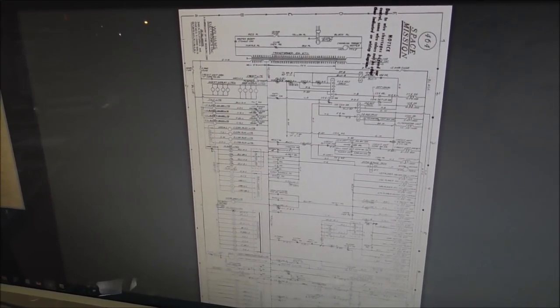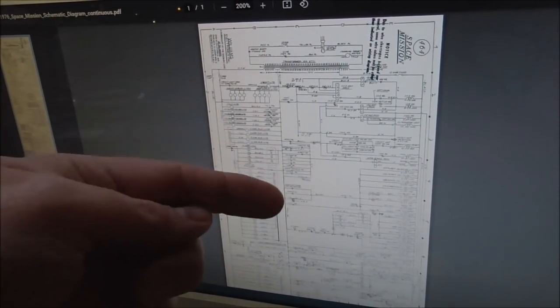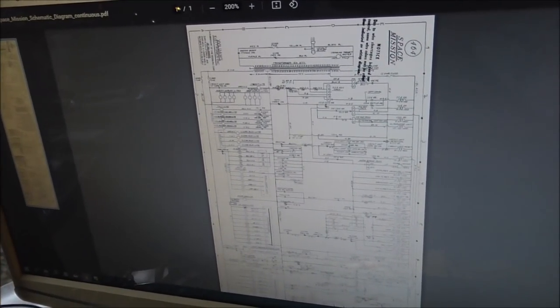Okay, folks, if you watch that footage closely, there are two clues of what's going on. It appears that it's doing it every time it scores 5,000 points. And it also appears that the score motor is moving the whole time. So if you listen, it's not just 1,000, 1,000, 1,000, 1,000. The score motor is moving down underneath too. So that's our clue as to what's going on, okay?